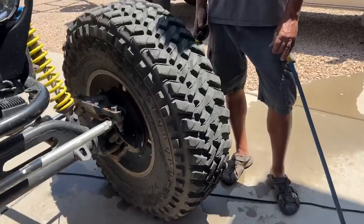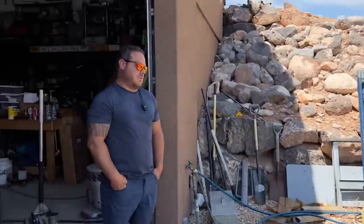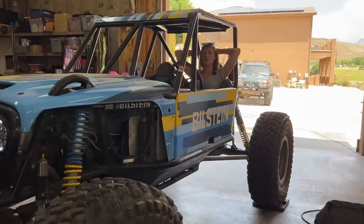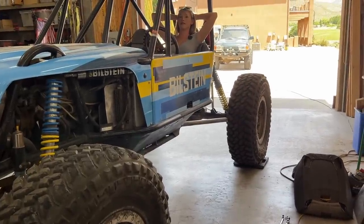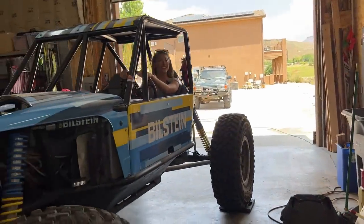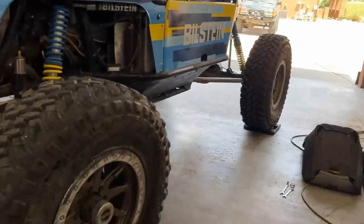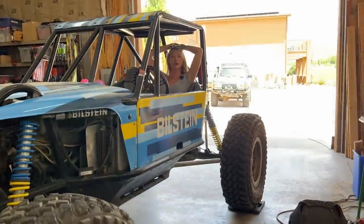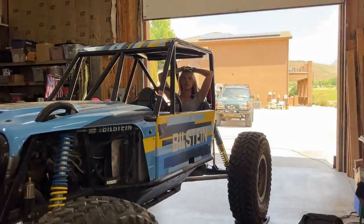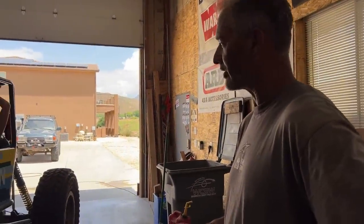It'll be a little squattier because of the water. Letting a little air out to get us to four PSI. We were 4,010 before. I'm going to say we're now 4,410. I'll just say 400 pounds added. 4,380. 4,373. Damn — close! We both went over, so nobody wins a prize. Price Is Right rules. 4,375. So about 360 to 365 pounds added — 580 pounds of tire weight total. What is it front-to-back now? 28 and a half times two — so we're almost at 57-58% front. We're close enough to call it pretty darn good. Without doing too much up there. Hopefully you don't break stuff now. Basically 58-42 — good job, that was a hard day's work. That's a good starting number without getting too much water. Drive it, go test it, get it on some stupid vertical stuff.